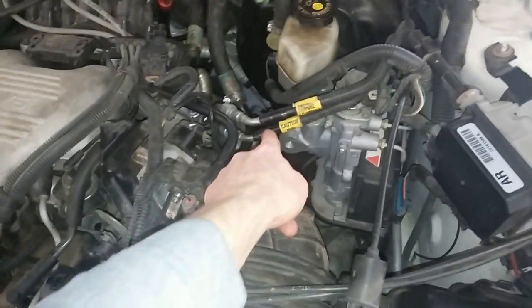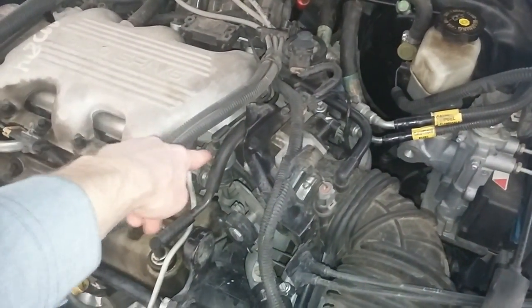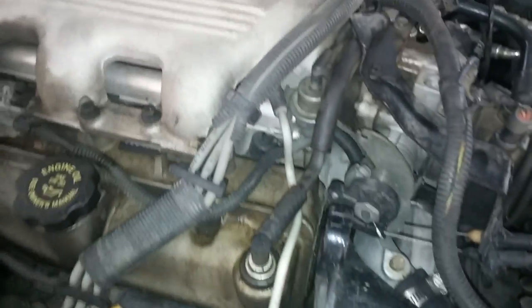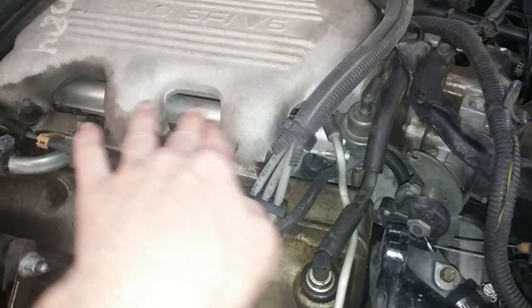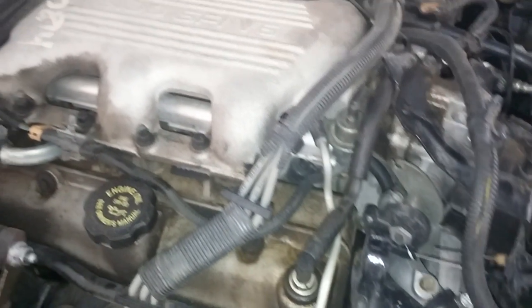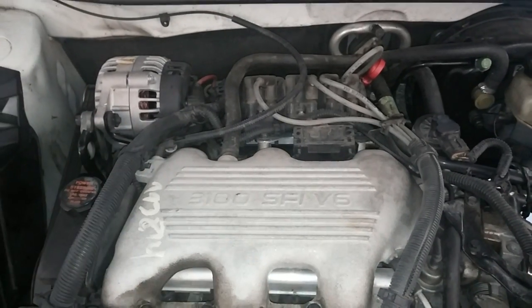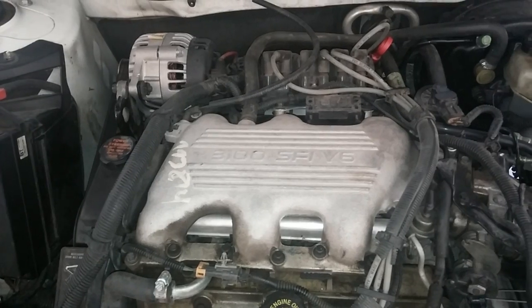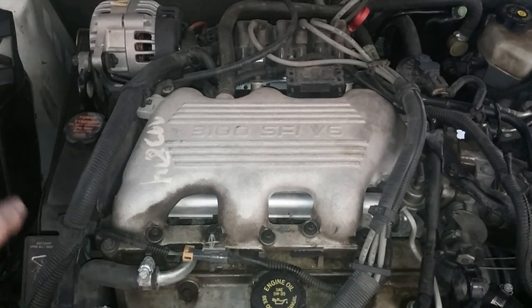So, you've cracked the line open. Let's say you have good flow through there, then your pump is definitely suspect. On your return line, you have good flow. If not, you'd probably have pretty high pressure in the rail, and this guy would not be sending it back. How this works is it's got a vacuum line here, and then there's a little diaphragm with a spring under it. As the high side pushes against that diaphragm, it regulates the pressure to a constant pressure — I think it's on this car around 35 to 40 PSI. So if you're not seeing that 35 to 40 PSI in your rail, then your pump is probably out. It should build up to that pretty quickly when you turn the ignition on, but don't start the car, because that's how you're going to test it.